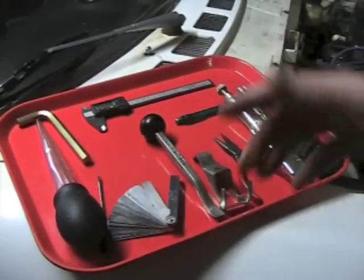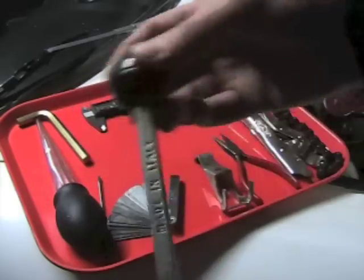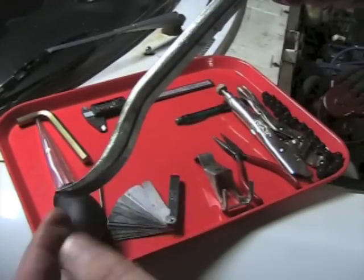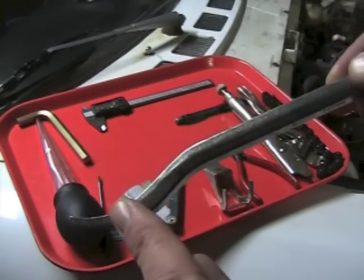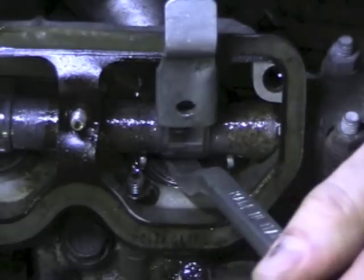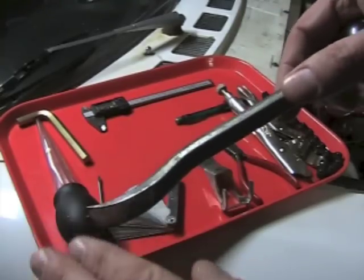Next, you're going to need something to pry with — it doesn't have to be this exact tool, but this is one actually intended for Fiats. I got this out of the trunk of an X19 I had years ago. Notice it's got a curved shape to it, and this is going to help you gently pry down on that bucket tappet and shim without scraping or scratching anything. This is what you're going to use to push that spring down.